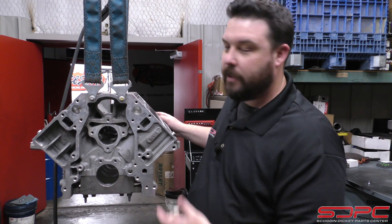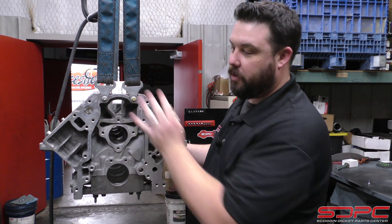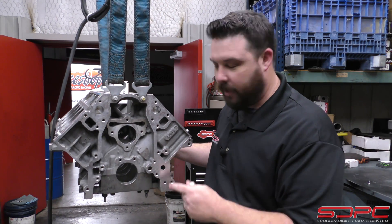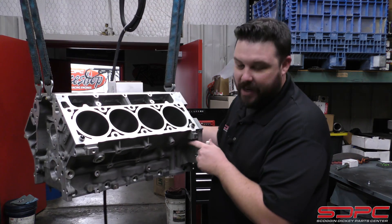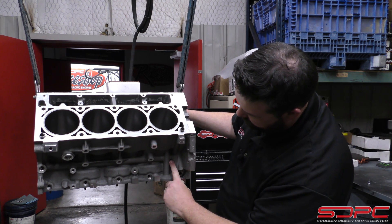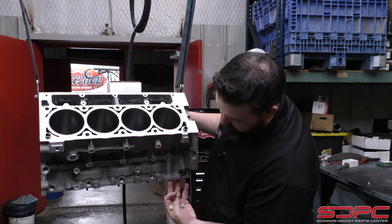It does have to be hammered in. I know some of these are threaded, but there are still a couple that have to be hammered — it's actually not that bad. You really have to put this in or you get no oil pressure; it will not seal off with the timing cover. We actually get some calls where people assemble their own stuff, they actually know what they're doing, and they just missed this one thing. So you definitely need that. And of course the threaded one on the side — you can actually see it here in the casting. It goes all the way back and then turns 90 degrees down. This is where your oil filter is. It's part of the oil pan, but it seals up against the block through two holes right here.